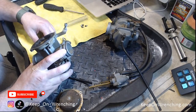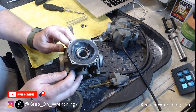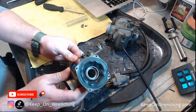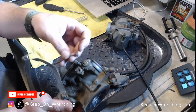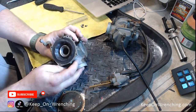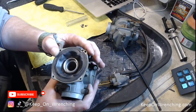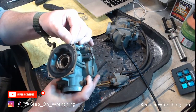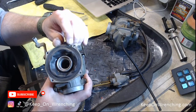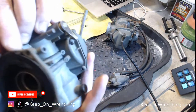Take your time. I was able to pick up a set of JIS screwdrivers for about $20 on Amazon — there's a link in the description of my videos. I just pulled this little piece off here — it's a broken throttle cable, so this is junk. Now, here is our diaphragm. On the surface it looks okay, but it's out of position — there's a little tab that needs to go into this notch, and somebody put this diaphragm in a little kittywumpus.